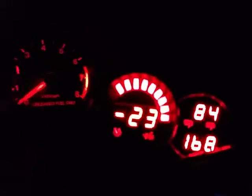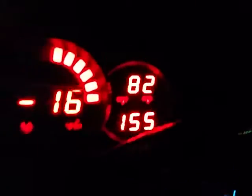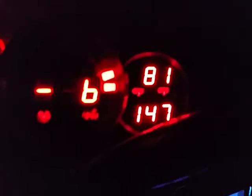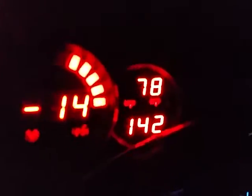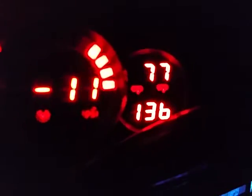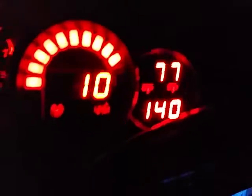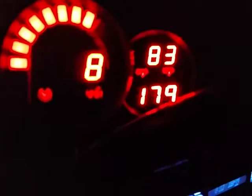You can definitely see, looking at the intercooler gauge, just how important it is to have an intercooler. I'm trying to drive and do this at the same time. The top number is the temperature that comes out of the intercooler; the bottom number is the air coming out of the turbo. As you can see right now it's 138 degrees, but you start putting boost on top of it, that stuff starts getting hot quick.